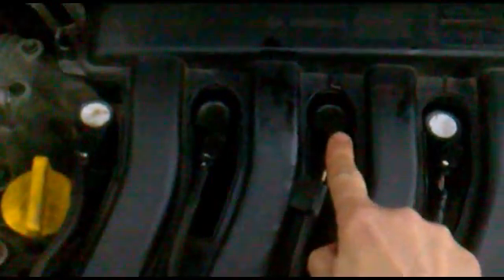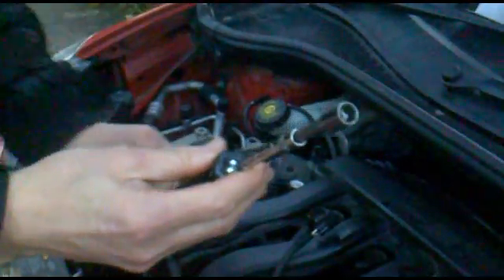So we'll have a look at number 2. In order to remove the low tension plug, just push down and pull — you can do it with your thumb actually. Now we need a tool like this: about a 10mm socket on a screwdriver adapter, so you can undo the nut which holds the pencil coil in.